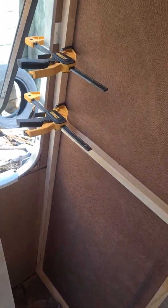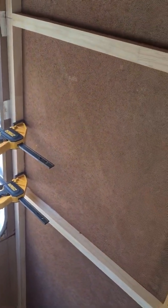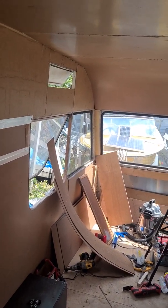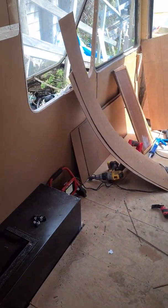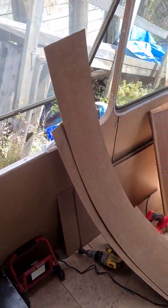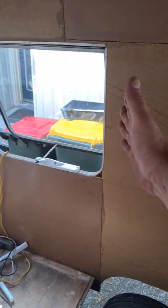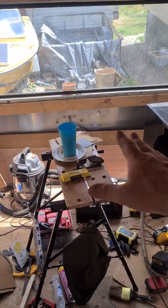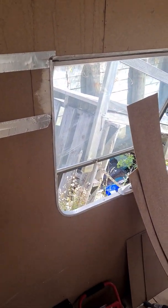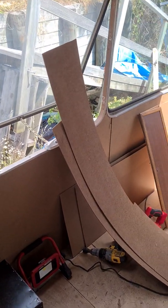And that's clamped up too, there's a bit of a gap there. There's still a tiny little bit of flex throughout the whole Caravan, because I haven't got a rib around here yet. I'm going to chuck one of those up in the middle after I've built everything in where there's space left. Probably over here, so there'll be another wall, same gauges, a bit bigger. On this side there'll be a bathroom, a partition here, and then here will be the start of the bunk beds. Small cupboard here, bunk beds, and couch slash bed there, and then there'll be a rib running all the way along here to reinforce and lock the whole thing, tighten it together, and that'll pick up that slight bow. It's only about 20 mil throughout the whole Caravan, so not too bad.